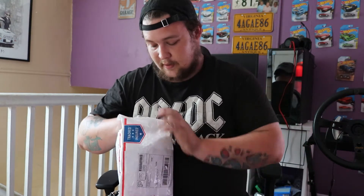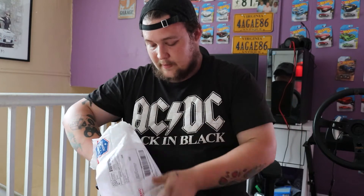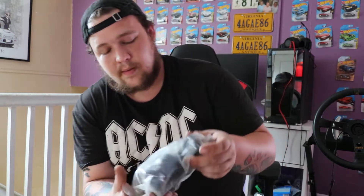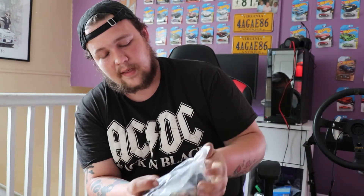I ordered some eBay solid mounts. The main reason I ordered this was just for the transmission mount. I'm not sure if I'm going to use the hockey puck mounts or not. I had them on one of my other 240s a while back — like eight or nine years ago — and these things are very very violent, they make the whole car rattle. I still have good OEM mounts up front.